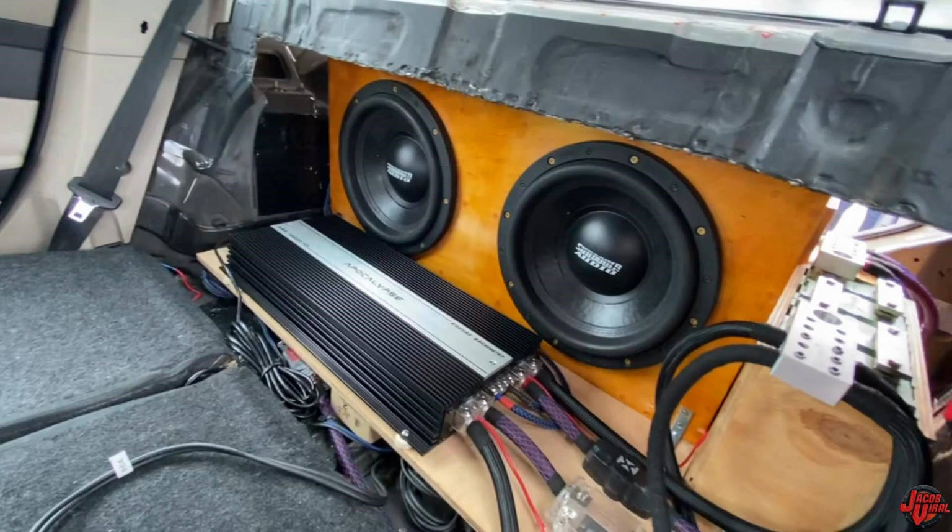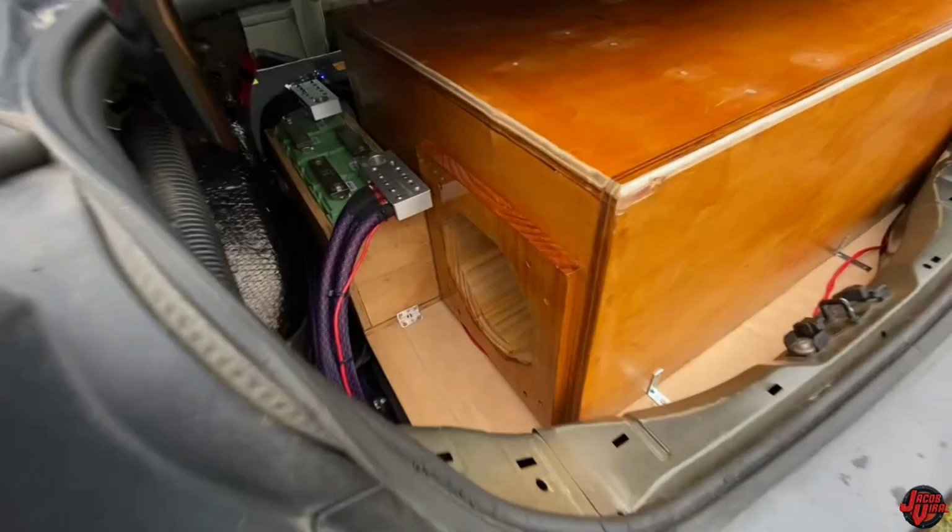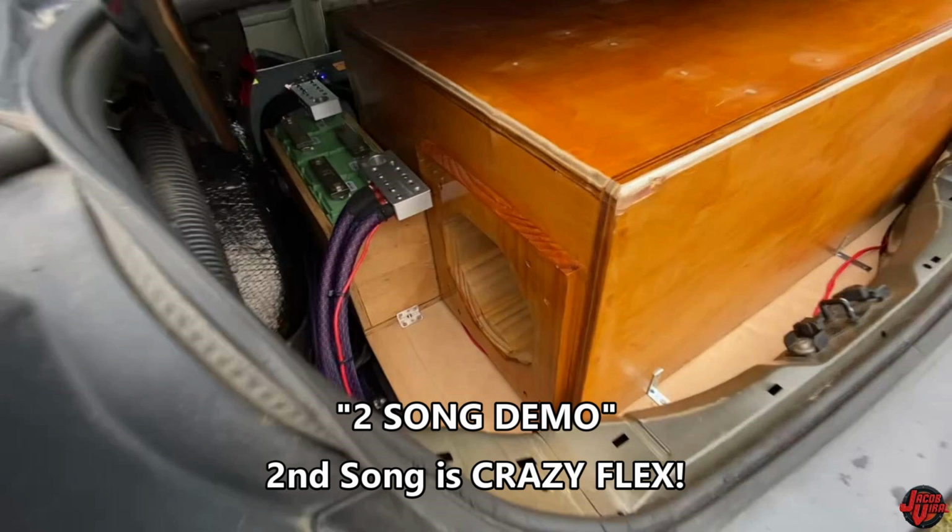Really like the amp layout staging he has set up. Having the amplifier in front of the subs instead of mounted on the box is definitely a plus. Some people have always commented, I've noticed, and said, well, why would you put the amplifier right here in front of the actual subwoofers? Well, at least he has it mounted on another platform instead of on the box, so less vibration issues. And having this octo port, I didn't get the exact measurement size of it. It looks like around a 7 to 8 inch octo port size. And he said the tuning was 29 hertz, so it definitely goes deep. And you can see he has some brackets holding the box down, so it definitely didn't move much.